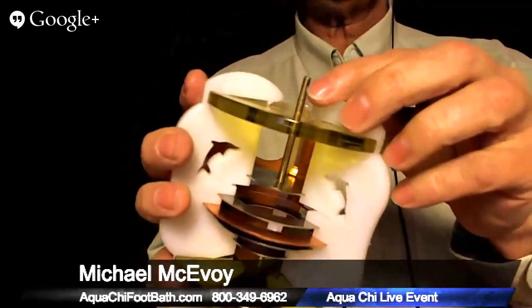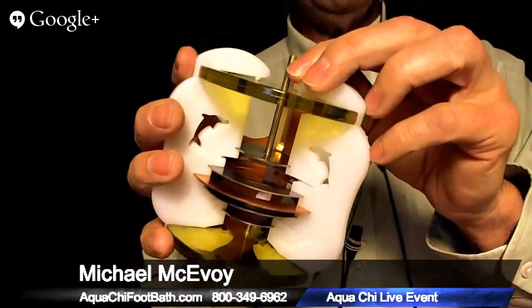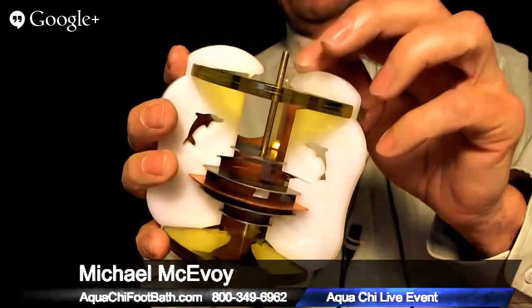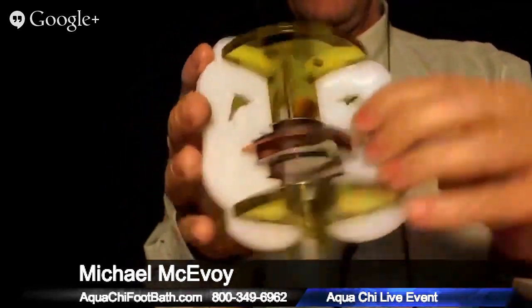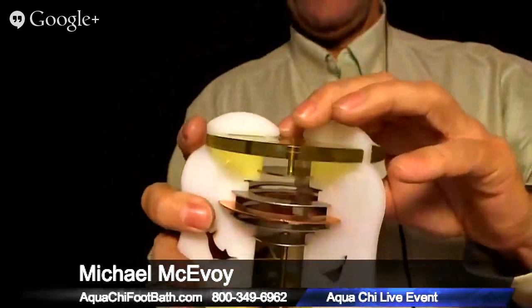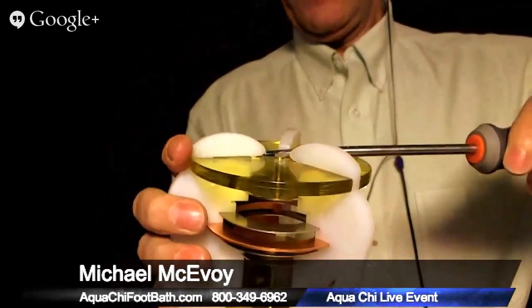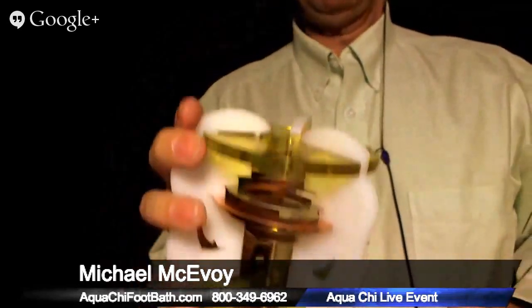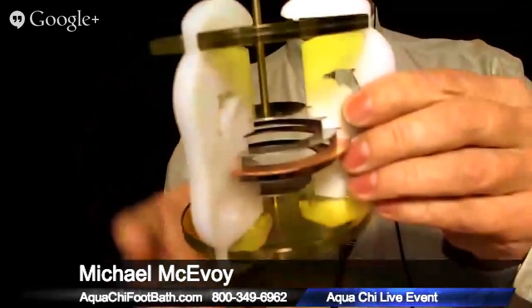So see what I've done here? Look closely, and you can see that it has been lifted up enough that you can see a white tab on the top of the module. Once you've got that side up, flip it around to the bottom of the same leg, and we're going to do the same thing on the bottom. Lift slightly. And then once that's lifted, you'll see that both sides have been lifted out.